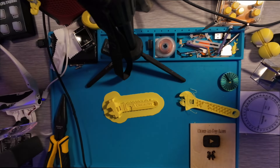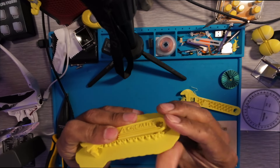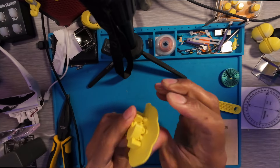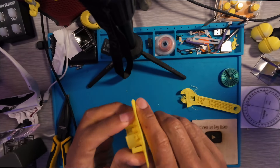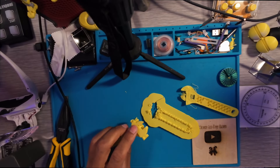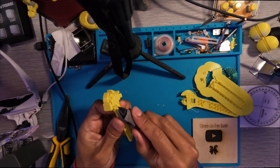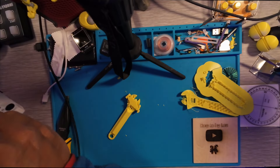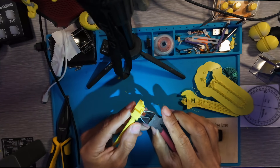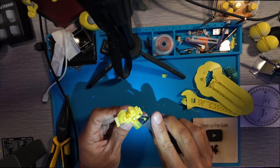There's the other wrench that didn't work — I stopped it because it had no supports. With tree supports you can just tear it right off. Now, you can't print this on a raft alone because the tip of the wrench is in the air — you can't print into thin air. So there I am with the pliers, plucking away little by little to uncover the wrench.